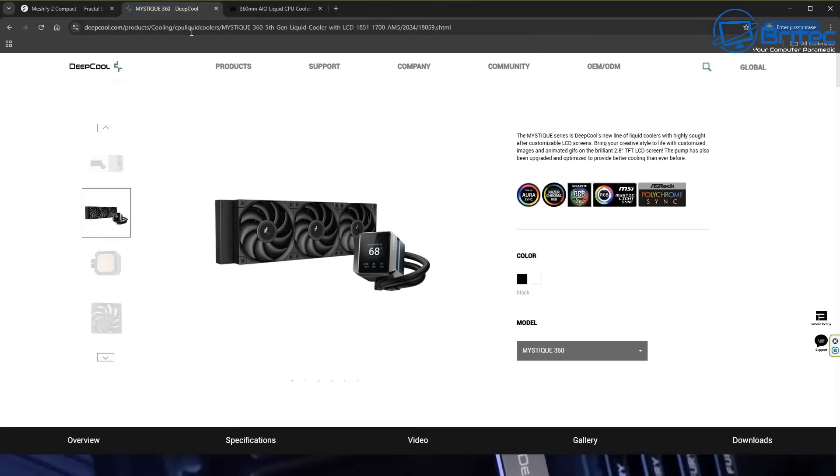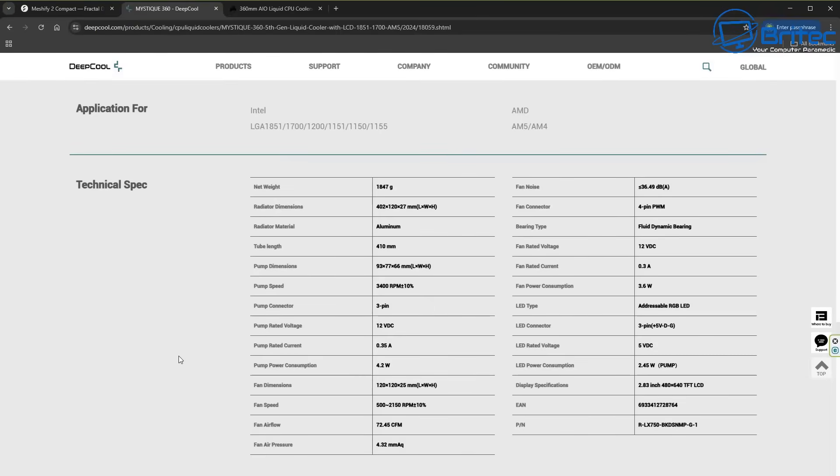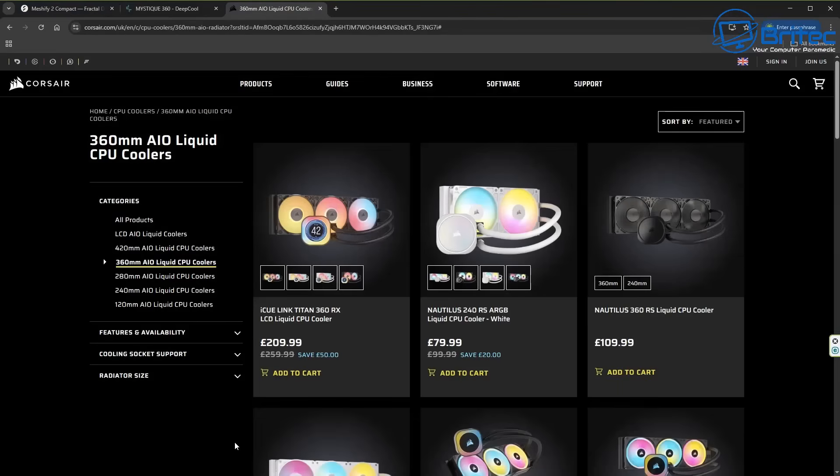But there's more to take into account than just the actual radiator. Let's head over to Deepcool's 360mm all-in-one cooler. We can see in the specifications that it's more than 360mm and yet it's listed as a 360mm all-in-one liquid cooler. Right here on the specifications, the radiator dimensions are listed at the very top — the length of the radiator is 402mm, not 360mm. The width is 120mm and the height is 27mm. This is important because when you put this in the front of the case it gets closer to where the GPU is, so if you've got an extra long GPU it just might not fit.